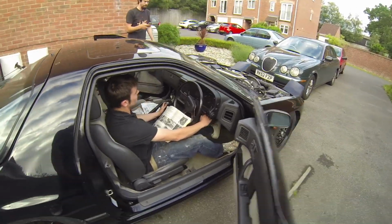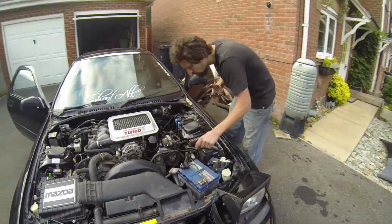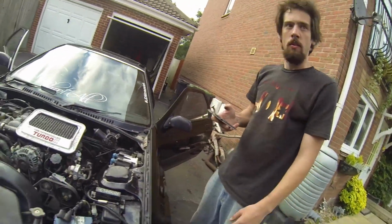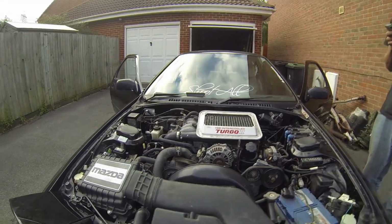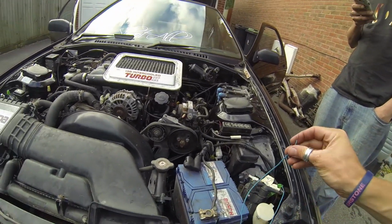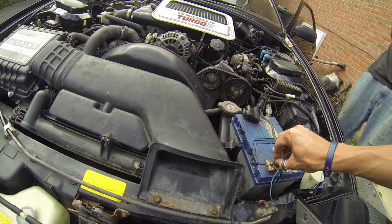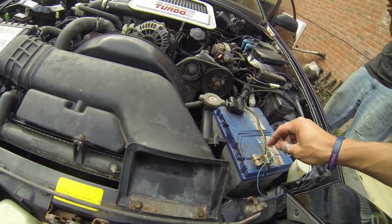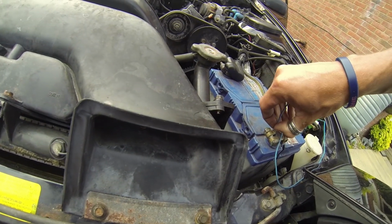Okay. Sweet. So what's the procedure? Is it ignition off, and then? Right. Oh, is it on? Run it to the ground terminal on the battery, and then turn the switch to the on position. Check engine light will flash. Hang on. And then you've got to start counting. Had to shove it in there nicely.